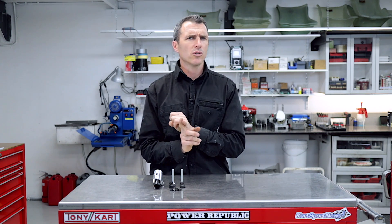When installing your unit, pay attention that the black shoulder is to the top and the Dynamic Kart Steering boss faces you as the driver. Now we're going to do up the grub screws on the dynamic steering boss. Push the steering shaft all the way into its down position and do up the three grub screws — nip the first one up lightly, then the second, then the third last.